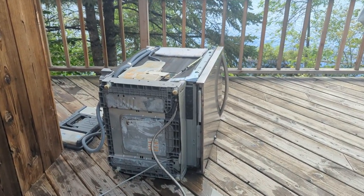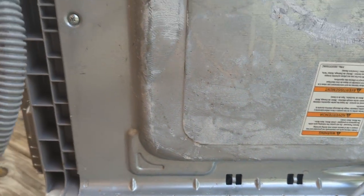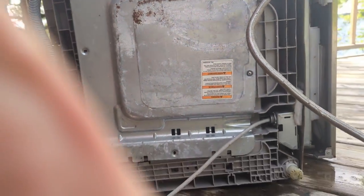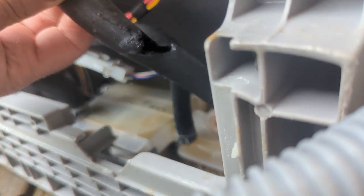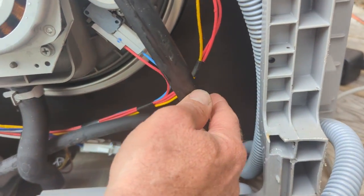Now let me show you how to fix it. I didn't even have to turn it on — I can see that this pipe going from the pump to this plastic fitting is split and leaking. I got it flipped on its side and there's just one screw holding this panel, so let's pop that off. Oh wait — it's not freeze damage — a frickin' mouse ate it! So that was mouse damage.